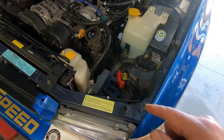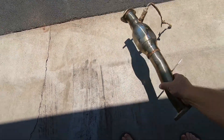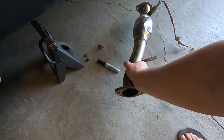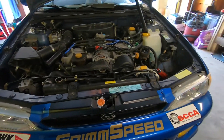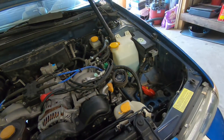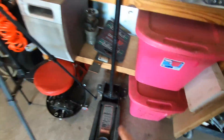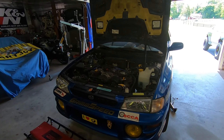It's got oil but no coolant. Still need to do the lower hose and get the exhaust on — it needed to be clearanced just slightly. It's out here drying and cooling because I had to spray it with water, heat it up with a torch, and give it a little persuasion. Got some extra clearance, so I'm going to put this up underneath there and bolt that up, then lower radiator hose, coolant, and a few other little things. I'm not going to put the skid plate on because I want to check for leaks first. Always have totes full of extra bolts — super handy when you lose one. Going to get under there and hook the exhaust up, and then we should be ready to start this bad boy.